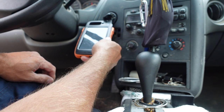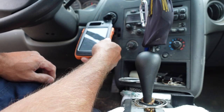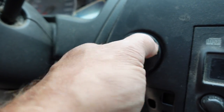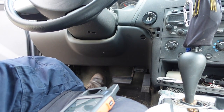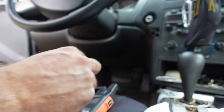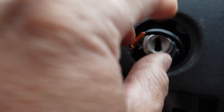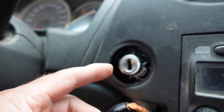At this point I'm thinking we'll check where the fuses are and also pop this coil off to see if it's damaged. If you look inside, this ignition lock cylinder is pretty wobbled out — the key is super loose. These things have a lot of issues. Let's see if this ring will pop off. There's the problem, ladies and gentlemen! The transponder ring — it's actually got an open circuit and it's not attached. That's not going to let it start and run.